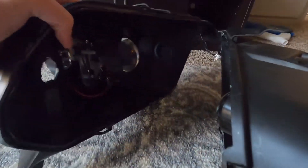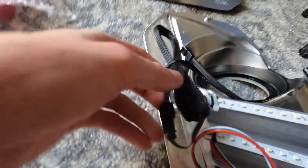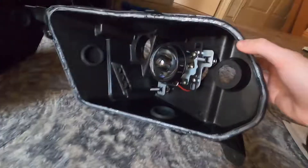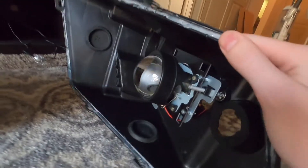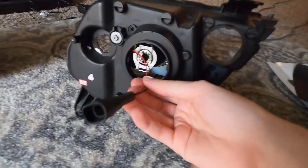You've got to make sure they line up with everything in here and that the screw hole is accessible. You can see where the old stuff was - this whole area should be fine to attach stuff. Here is the projector all mounted up. I tested it - I hooked the high beam up, heard a noise and a light came on, then disconnected it because it was just loose leads - a little scary to be honest. It works. Got the other one mounted up as well, all secure, nuts and bolts tightened down with locking nuts. I ran the high beam wire out.